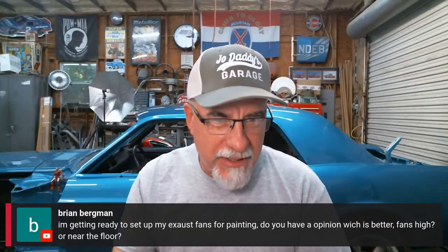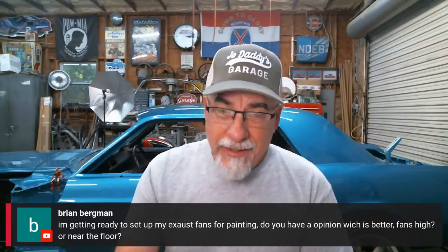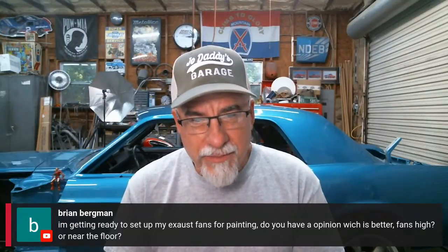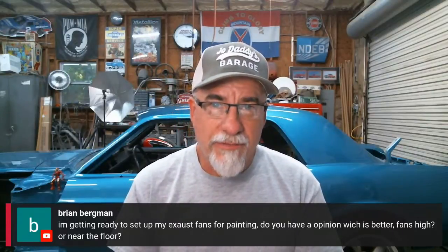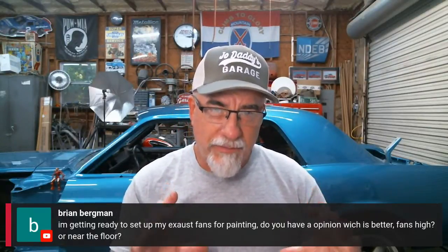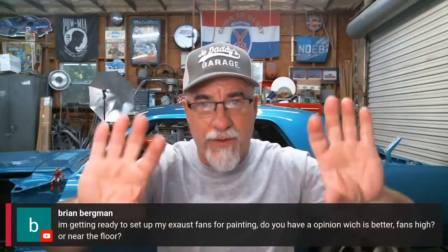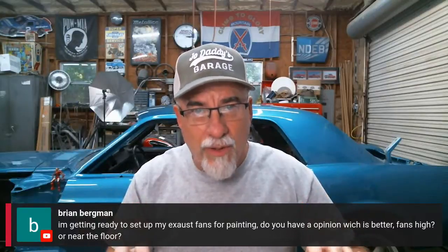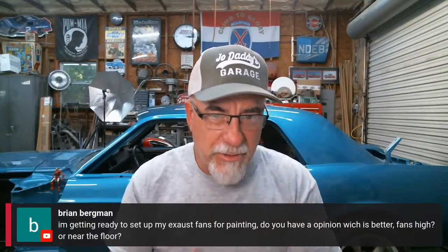Brian, I'm getting ready to set up my exhaust fans for painting. Do you have an opinion which is better, fans high or near the floor? Well, you really want them lower, I would say. Just my opinion. When we had our paint booth, the exhaust fan was at the bottom of the plenum, so it would pull things down and forward off of the car. The ones I have in the window work, but ideally they should be lower so that it's pulling air down from the top and out. So I would rather have them near the floor.